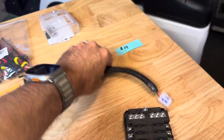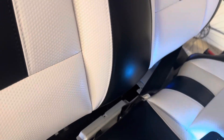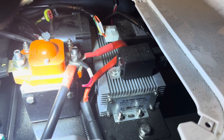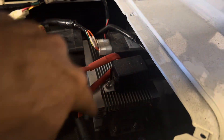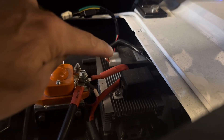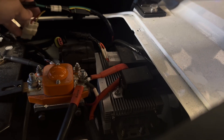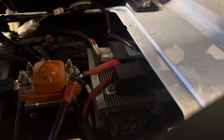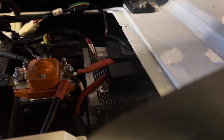Before we end, I want to show you one more time where we are tapping into the cart. You're going to go to your cart and depending on your model, you're looking for that silver box — that is the voltage reducer. You can see on the back it is taking in 26 to 60 volts and converting it to 12 volts. This box with the fins is what we are looking for. The plugs are on the other side — coming out of the back there's a green wire, a red wire, a yellow wire, and a black wire, with two clips on the back. We're not going to use the one that is red and yellow; we're looking for the green and black. You're going to unclip that and put ours in.